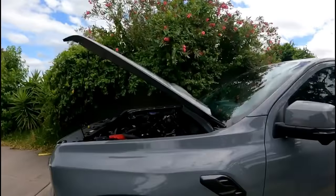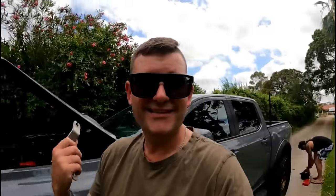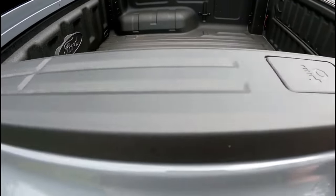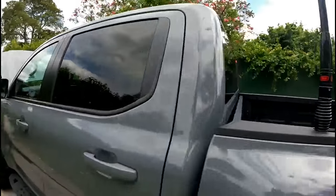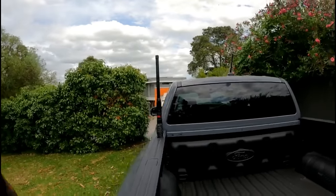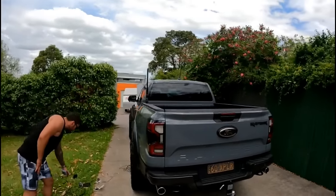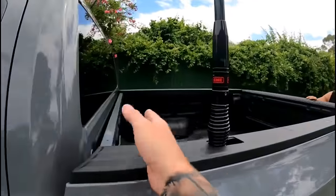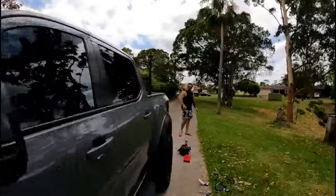Destination change — we got the old bonnet bracket for the UHF aerial, and we were a little bit hopeful it would fit on this. But being realistic, it's a completely restyled front end, so the old GME bracket does not transfer to the Gen 2 Raptor Ranger. But what we found is these little plates have holes, and it turns out that hole is the perfect size for the GME Stumpy 2.1 dBi. Looking at the back of it — up, out of the way of the cab. If it does get hung up and flicked back and forth, it's not hitting the cab. We're looking at 25-30 centimetres from the back of the cab. Looking down the side of the car, you don't even notice it. That's the spot.